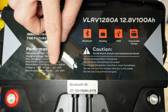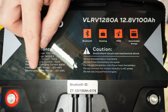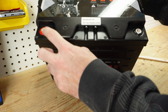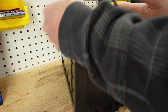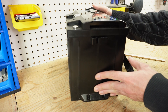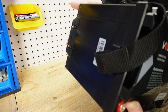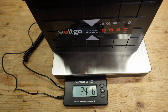We also have a charging temperature range of minus 20 to plus 45 degrees Celsius, because this battery actually has heating. The discharge temperature range is minus 20 to plus 55 degrees. Down here we have our Bluetooth ID on a sticker, epoxy terminals on the positive and negative, and a very heavy duty nylon strap that is easily removable. The battery weighs in at 24 pounds 6 ounces.